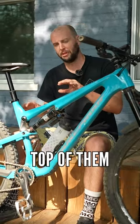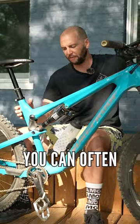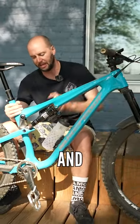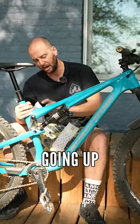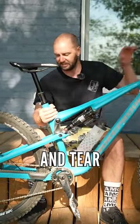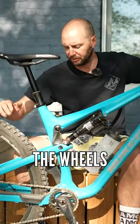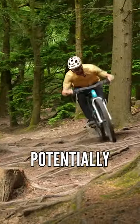You're going to have to keep on top of them. What you want to keep an eye out for is any knocking or play in them. You can often find that out if you were just to pick the seat tube up here and you felt like a knock, like going up and down — then that is something that could indicate wear and tear. Also, any side to side flex — if you were to hold the bike and flex the wheel side to side and you could hear it knocking. Obviously that could be the wheel, but potentially something going on in a pivot as well.